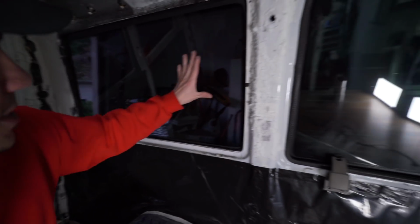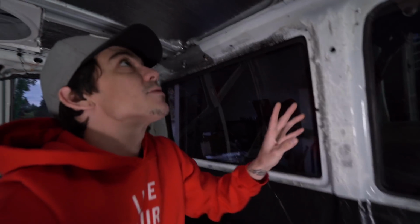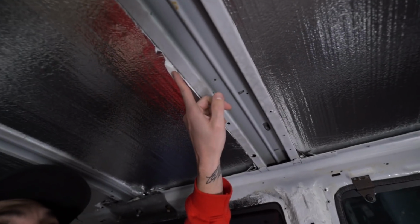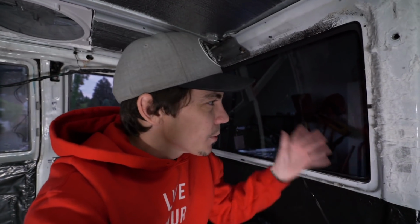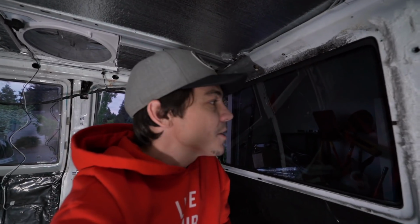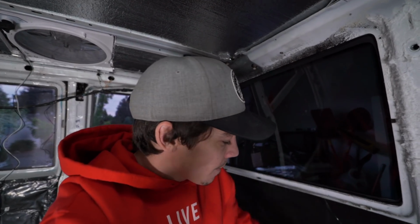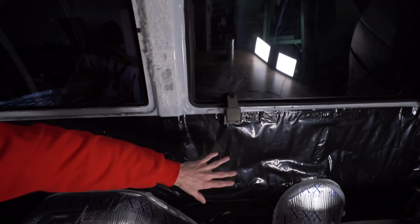So 1/2 inch foam insulation all the way across this. There's at least 3 different types. There's the cheap stuff with the big balls pretty much melted together, and then there's XPS, and then there's another kind, I forget what it's called. I'm gonna go with the mid-grade stuff, I think. Still researching that, not fully decided. But this stuff, I guess, is a little less resistant to moisture than the more expensive kinds. So I want to get that on here, and then I'm going to do another layer of this moisture barrier over the whole thing.